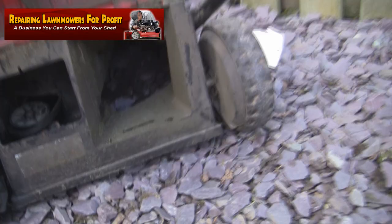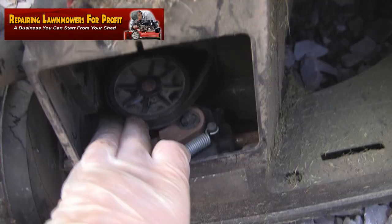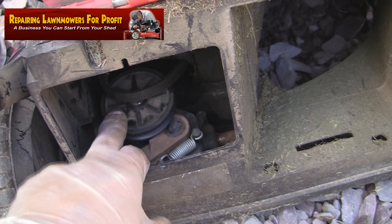I've got my handy helper Dave here holding this deflector open as I've forgotten my tool outside to hold it. I've got this deflector open — as you can see, the belt's now nice and slack on the back. There's not as much resistance now so we can get that belt off. As we take the belt off, you'll notice that the driver moves about a lot more freely, as I've taken the spring off this side as well.